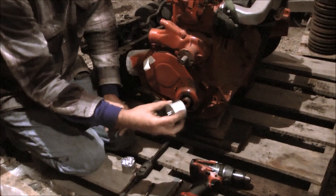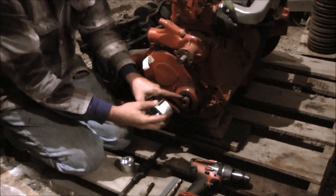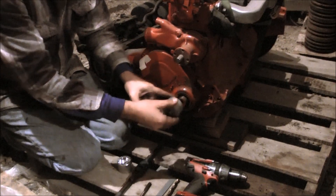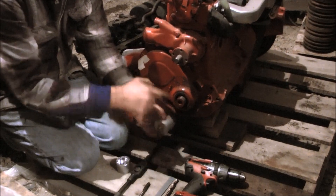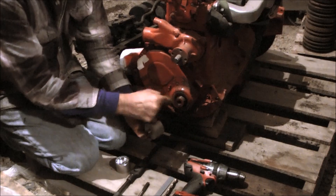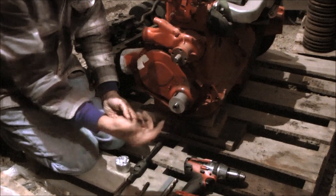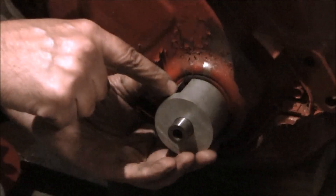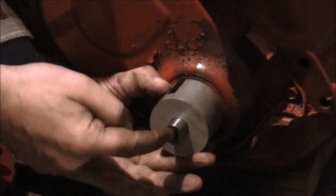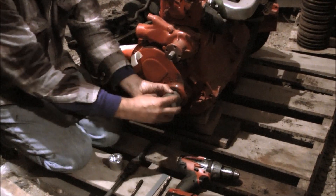What you're going to do is take this tool, and you see there's a keyway slot on your crankshaft. I want that keyway slot turned downward, so you turn the slot downward on your crankshaft. The reason for that is this does not seat all the way into the engine completely — it leaves a gap right here. That gap is where the chips are going to fall out as you're drilling, so they discharge straight down.